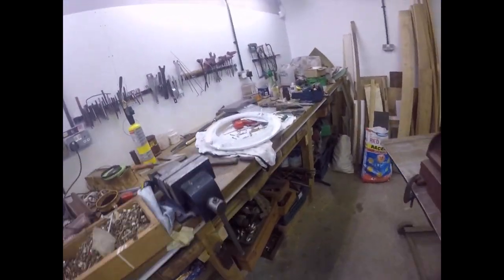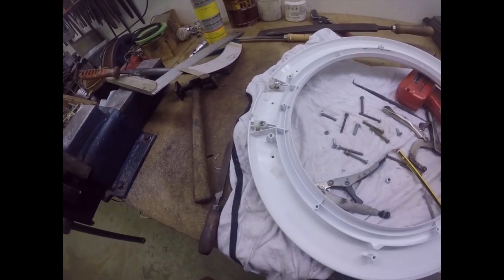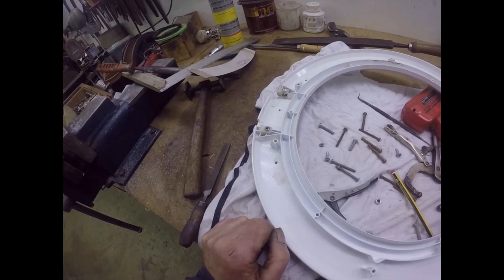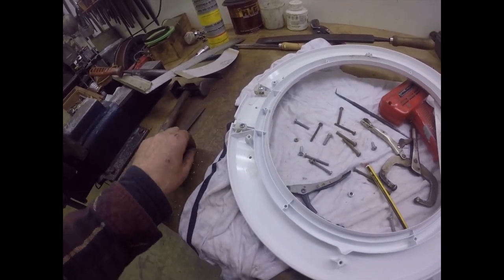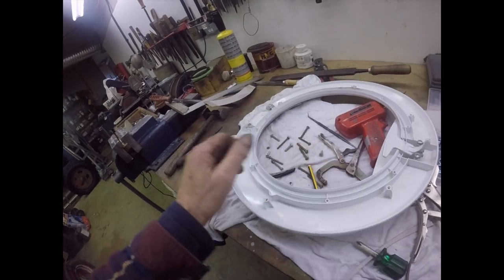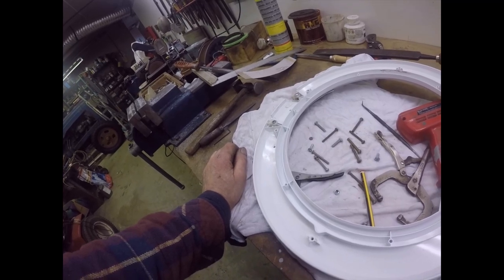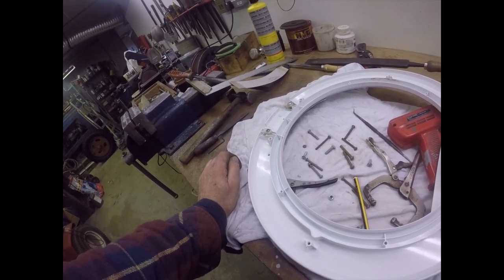I hate this sort of job, though I'm getting quite good at mending the unmendable and fixing the unfixable. The plastic moulding is £25 up to £45, but you have to get the one for the right art number, and mine is art number 03 and I can't find a door for that. Given that I also tried to source the correct pump — when it arrived it was an earlier model with a three-screw fixing whereas mine was a bayonet fitting — I managed to find three self-tapping screws and fix it anyway since all the plastic moulding holes are there.